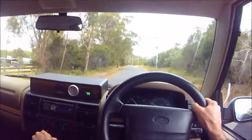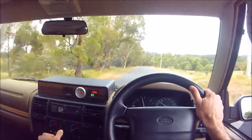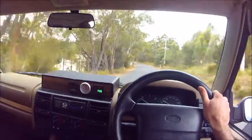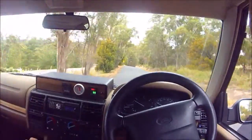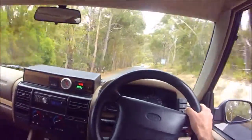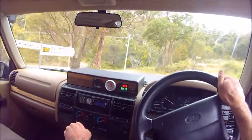And having the pump tweak has just completely transformed this vehicle. As I said, I just accelerate slightly and I can hear the turbo spooling up. And it spools earlier because I've turned 90 degrees clockwise the gear in the diaphragm to reduce the spring preload. I think they call it the star wheel. So all in all, it's been a very positive change.